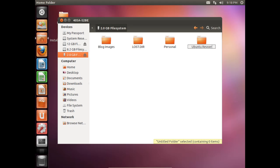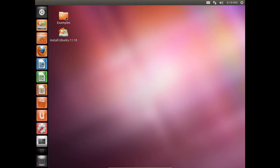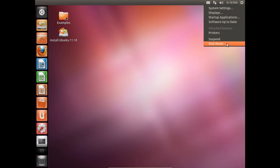There is the blog images directory that we rescued last time. Simply right-click on it and choose Copy. Click over on our USB stick — I'm going to create a new folder called Ubuntu Recovery. Go into that directory, right-click and paste, or use Control+V to paste. We can go in and see those pictures, and we can also manipulate them through Ubuntu as well. So the next thing we need to do is boot back into Windows to make sure we can access those directories. Unplug the USB hard drive or flash stick, go to another computer, and make sure those files are there before you decide to wipe and reload anything.